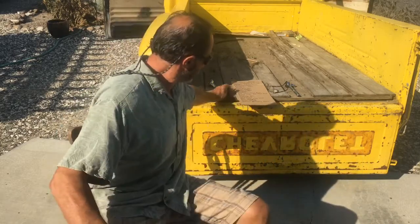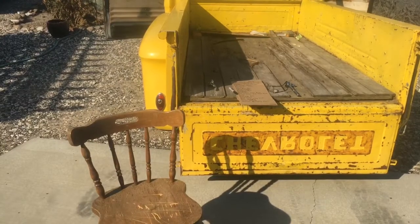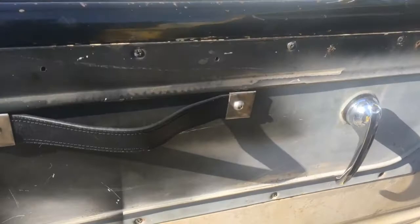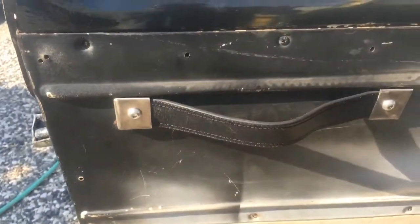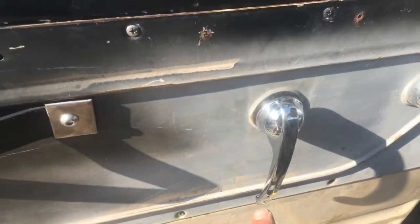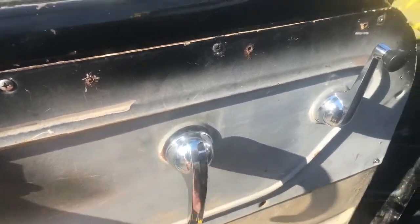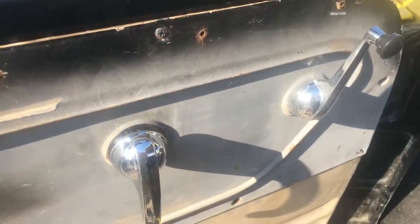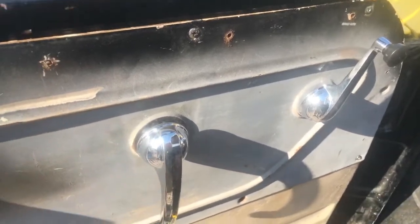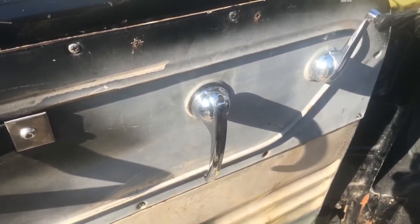Here's the door I already did — there's the strap in place. I'm still going to take off the levers and add just a little bit of Loctite on the screws to lock those down. If you put too much on and need to get them off, I find you just heat these up with a little torch and the Loctite comes off — that's a nice little trick.